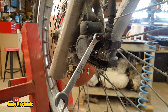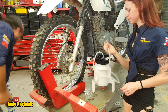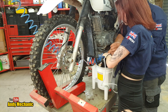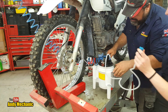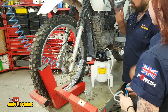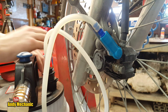Right Holly, here's the new vacuum bleeder tool. That's the bit that connects, and I'll pass you the airline. It's a brand new fitting — 130 PSI. There we go, we're in. Turn it on, twizzle the knob when you're ready. I'm going to clamber up the ladder and keep topping it off, and I'll move the camera so we can see exactly what's going on with the fluid coming out.